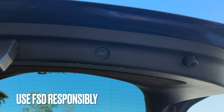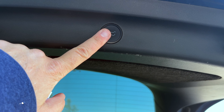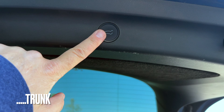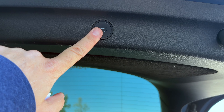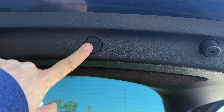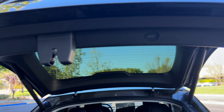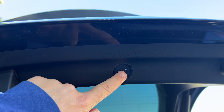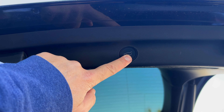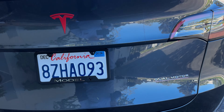If you have a newer Tesla, you've got a button that will open and close the trunk. But did you know this button can also adjust the height? If you want to open the trunk in your garage without slamming the spoiler on the ceiling, just manually adjust the trunk to the height you want using your hand, then push and hold this button until you hear the beep. Now it will always open to that height.